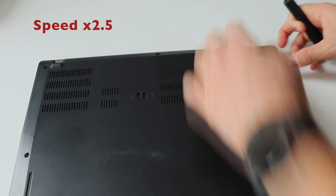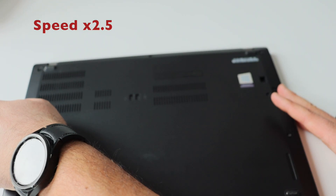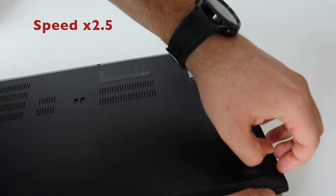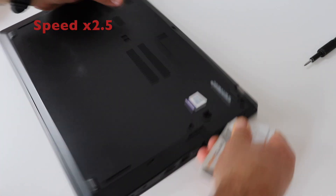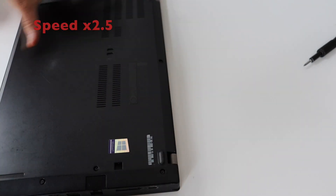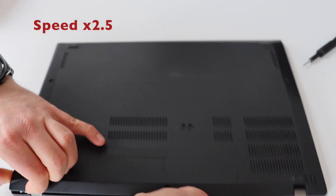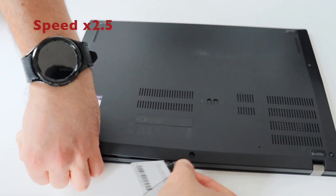I've already done this and now using a screwdriver I'm going to remove the back cover of the laptop. The disassembly process is straightforward and simple. There are several captive screws that I have to unscrew, and after that I'll use a plastic clip to remove the back cover from the main chassis so I can access the system board where the SODIMM slot for the extra RAM is. I used an old plastic card as a tool for this job.